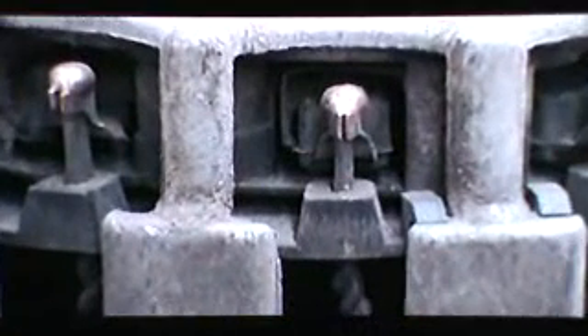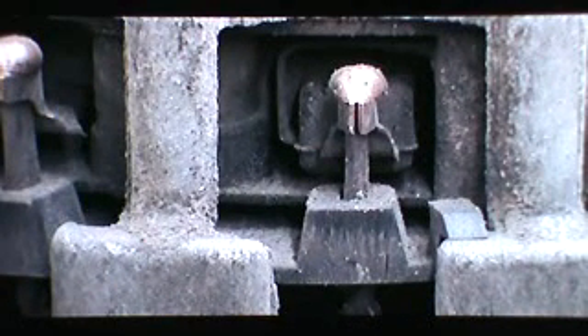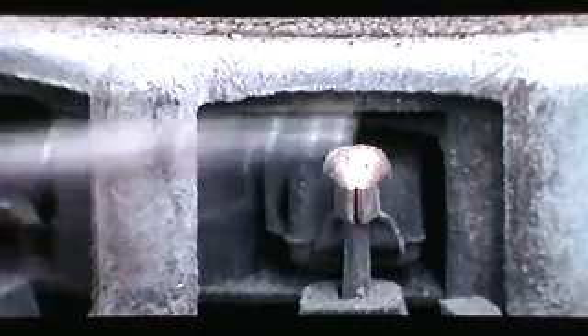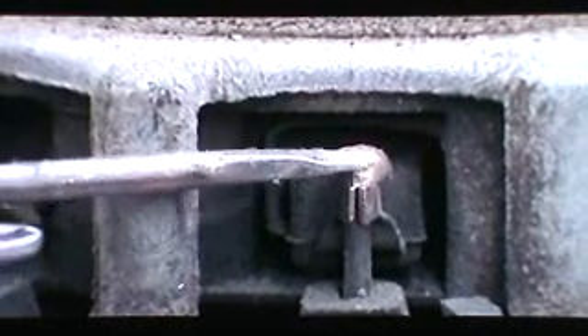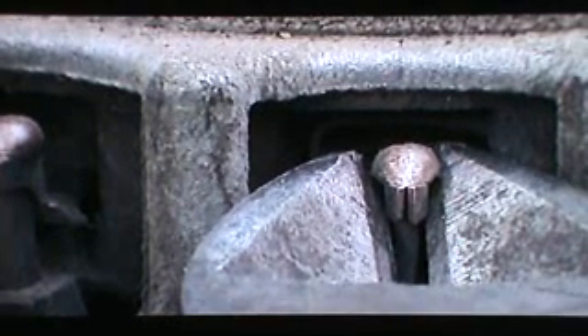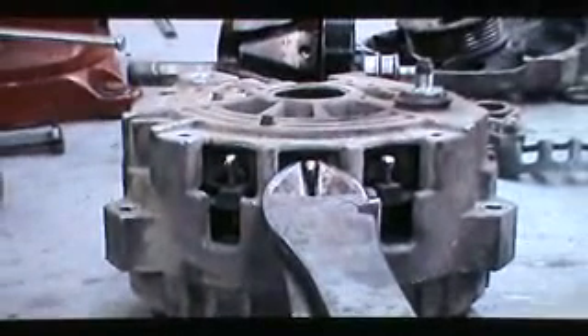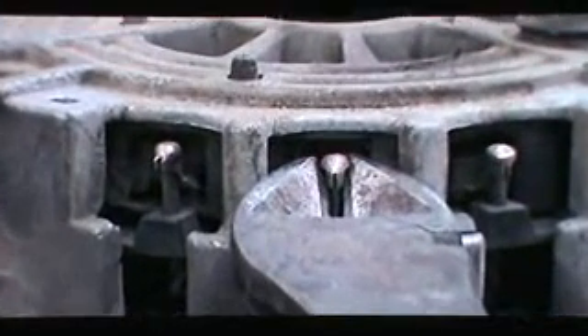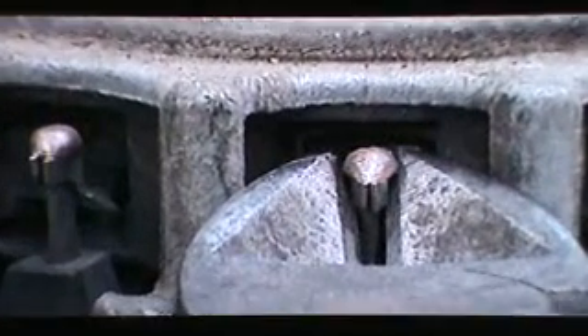This one has not been soldered — it's been welded. So we want to remove just the very top of the weld off the stator leads. You can see the split area right here; the weld only goes down to where the screwdriver is right now. So we're going to take a pair of side cutters and cut just the uppermost portion of it off — it's going to require some force.